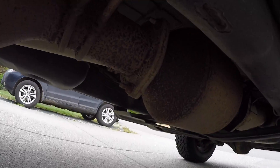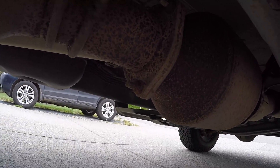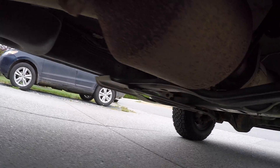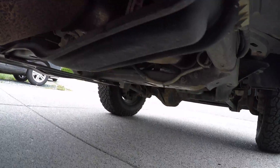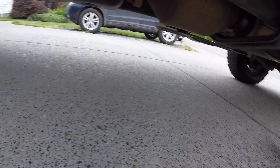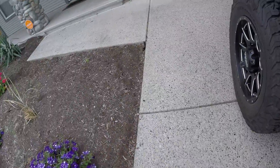Underneath the truck here, you're going to see a few rusted-on bolts that hold and clamp the exhaust together. You can see another one down here, and there is going to be another one down by the turbo which you have to unclamp as well. We're using a number 16 socket, and that'll basically be what you need to start off with removing the exhaust.